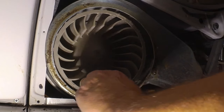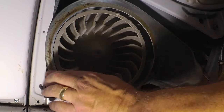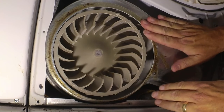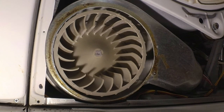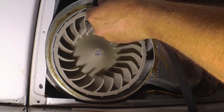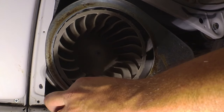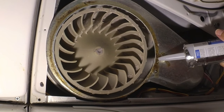A lot of surface on this bottom edge here to stick to, but the new foam gasket has a peel and stick adhesive, so hopefully if we just get it positioned in there, it will hold its place. As I pull this backing off, there doesn't seem to be much adhesive on here at all. So I think what I'm going to have to do is apply some adhesive. So I'm going to go into the garage and maybe get some silicone I can apply to this, and then I will try and stick it down. So the self-adhesive on the foam just kind of peeled right off.